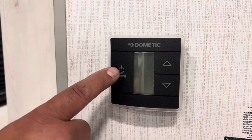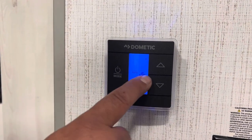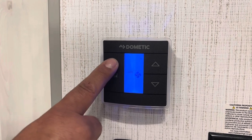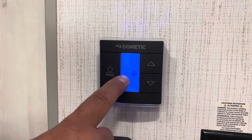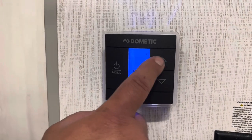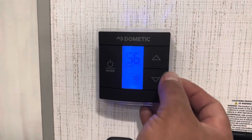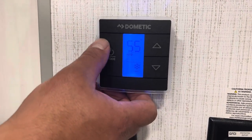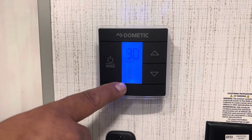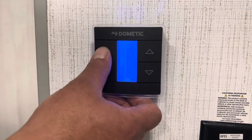For the thermostat — mode button and the two arrows. Gently slide it — it will say off. Keep hitting mode until you get to your setting. If you're running the air conditioner, always have it on auto. If you put it on fan, only the fan works — fan high or fan low just blows air, not cold air. To have the AC running, set it to auto. You can adjust the temperature. If you want the furnace on, tap the mode button to get to furnace. The air conditioner will turn off and the furnace will kick on. Adjust the temperature just like your home. When traveling and not in use, make sure to turn it off.